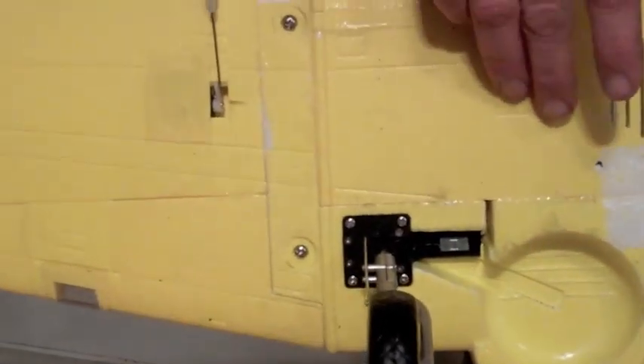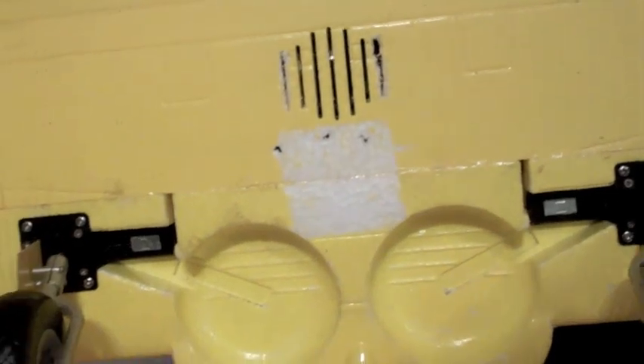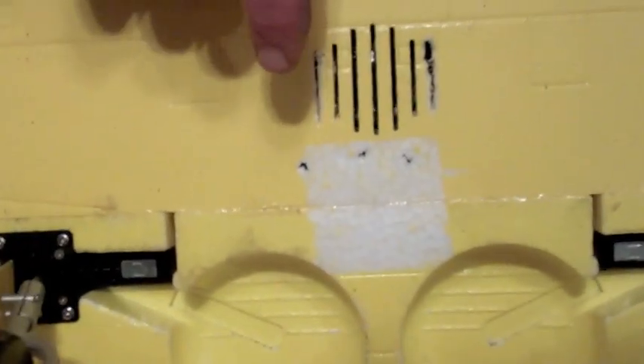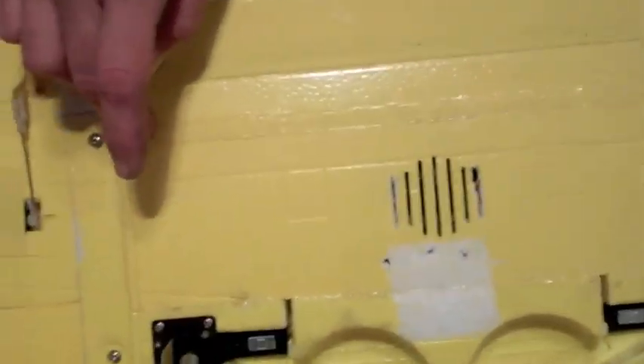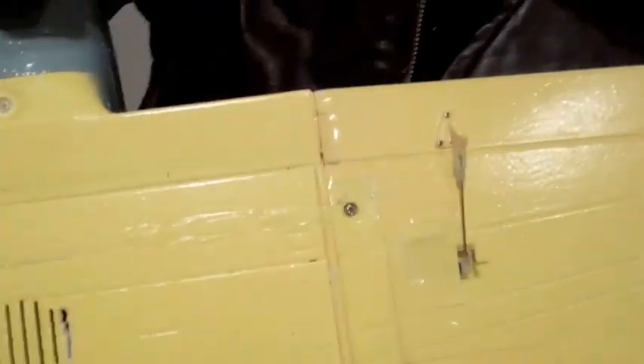Overall, a real neat aircraft. There were some things that were absolutely necessary for the bottom of the aircraft to be sturdy. The wing spars join underneath this foam panel and there wasn't anything holding those spars in but the foam panel. It popped loose on me one day and I was lucky I didn't crash the plane. So I used zip ties and lashed the wooden spar to the carbon spar and also used a popsicle stick as a mending plate and screwed it in so my wings aren't going anywhere. I also used CA glue around every little foam panel all the way out to the tip to really make it sturdy. This plane goes together like a puzzle — the lights are their own foam piece all the way out to the wingtips. A little CA glue is a real good idea.